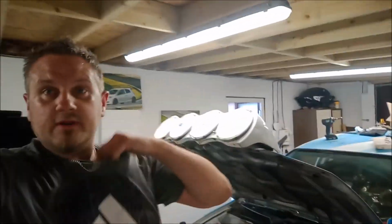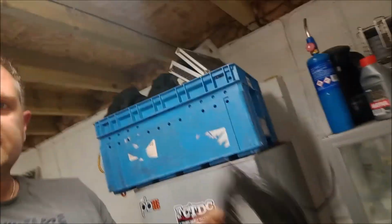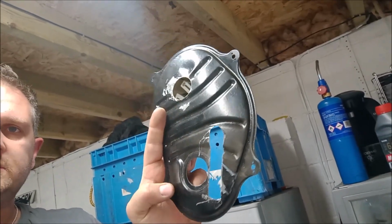So I've just been tightening up all the fuel fittings that we fit the other night. I'm on with that, and I'm also doing this, which is the top hat. I'm butchering it up, cutting a hole out, which is a little bit bigger at the top there. I'm just making some more cuts down the bottom there, to get the fuel lines so they're not snagged on them or rubbing against anything. I will put some rubber edging around that as well to stop it all rubbing.